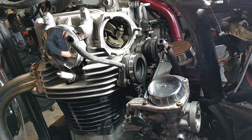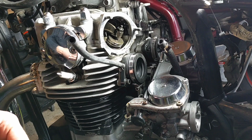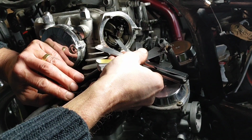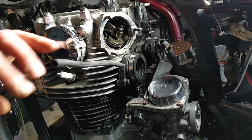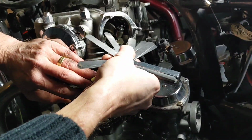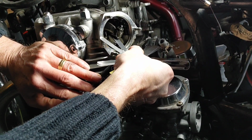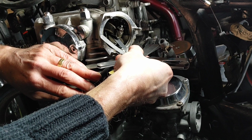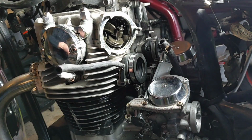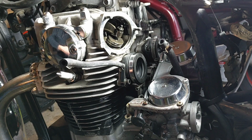This doesn't particularly help me, but let's just check to see probably what it is. So that is just under 0.105, 0.127. Yeah, 0.127 makes it under there quite easily. So that is a way off as far as the inlet valve's concerned. So where's my 0.05 that I was at a second ago? 0.06.